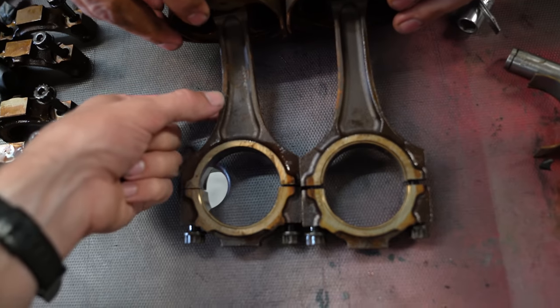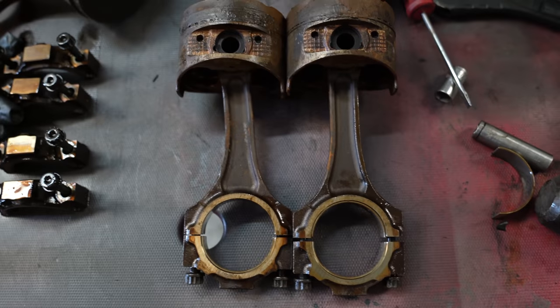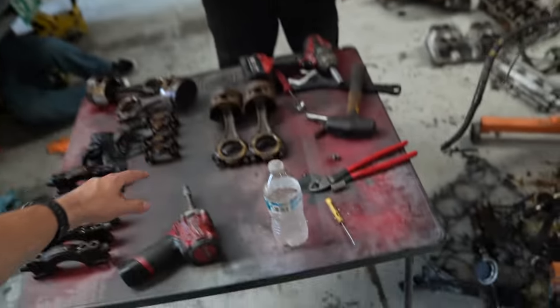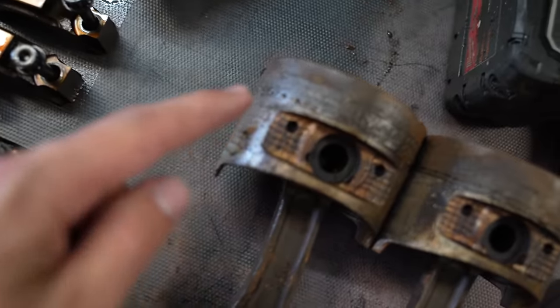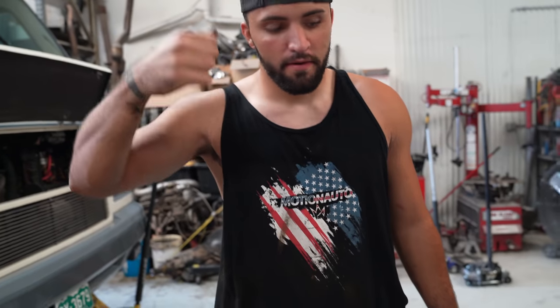You can see how it's kind of flared out right here and tweaks off that way, whereas this one is completely straight. That really sucks, but the reason is that it had all the water in the cylinders. You could see all that mud and dirt. The motor was locked up when we got it, so we put a 4-foot pry bar on the flex plate to get it to turn over. I don't know if that's what happened or...